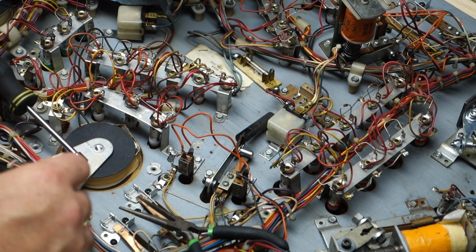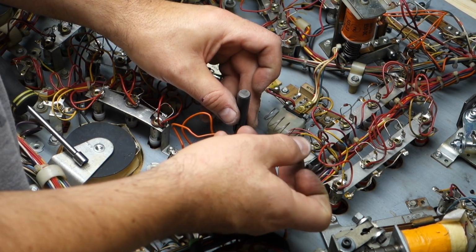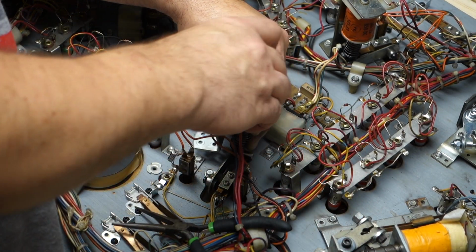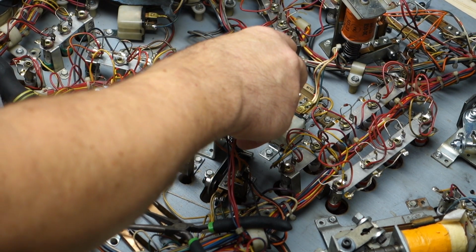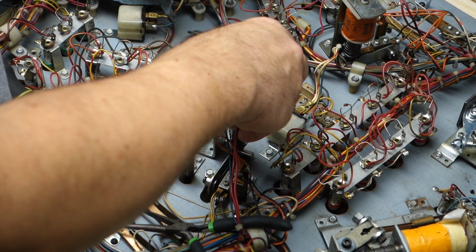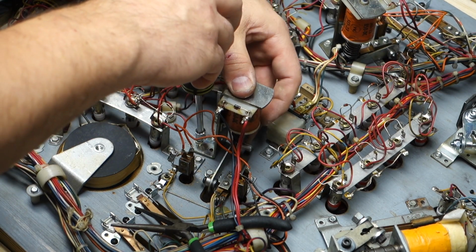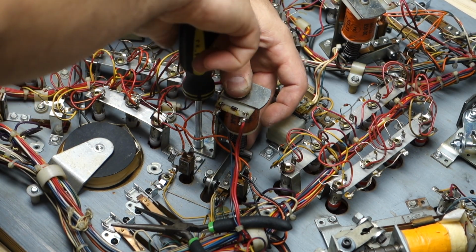That's good. Spring goes like that. There's a tiny end of the spring and a large opening. You see it's kind of cone shaped, small, large. Small goes at the end of the spring here. This is another one you've got to worry about binding. Binding is if you push the plunger down wrong, it's got to be on a certain little angle. It will be hard to put the assembly down, but then the slingshot won't go up and down. So as long as it goes up and down as you're tightening it, it's in the right spot.